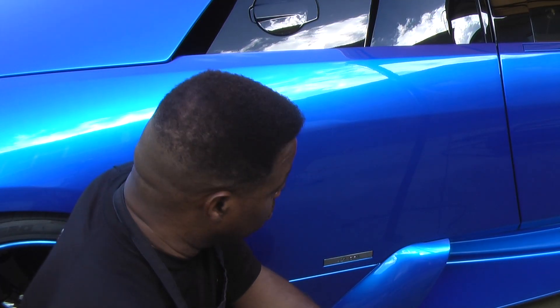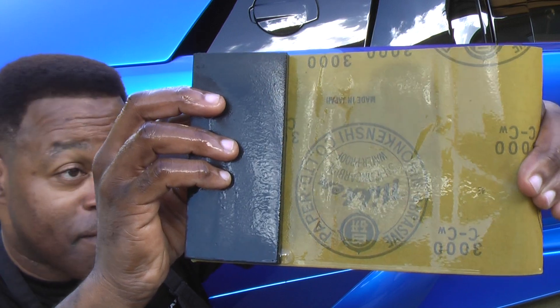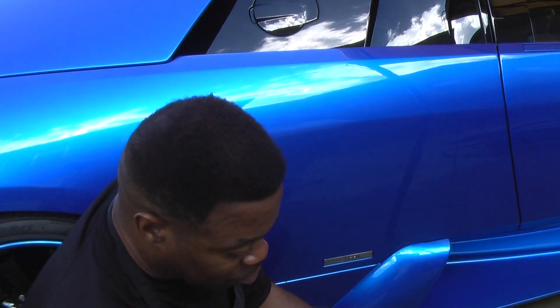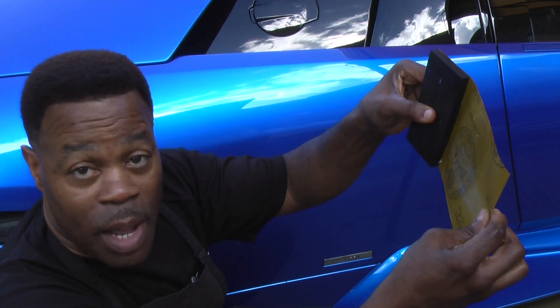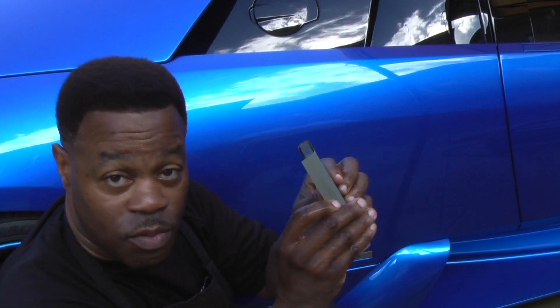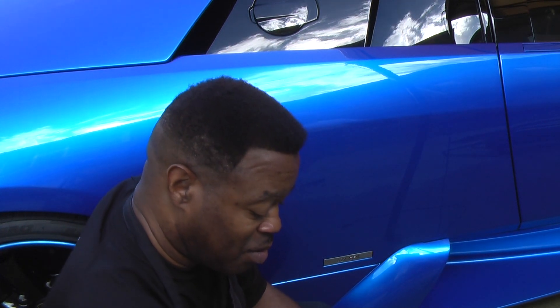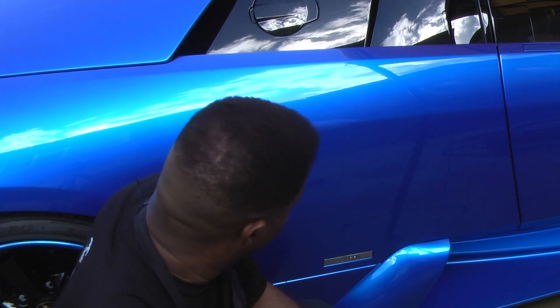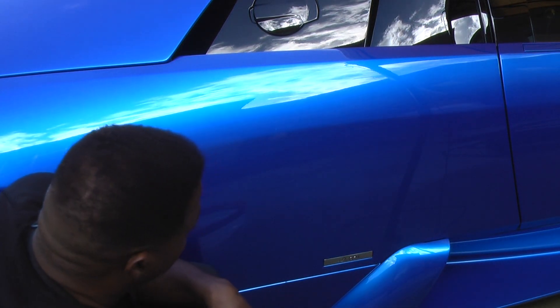They're not very deep. I can't catch them on my fingernails, so they're going to be relatively easy to remove. So here we go. What I'm going to use — those scratches are not too bad — is some 3000 grit sandpaper. That is probably all I'm going to need. I'm going to wrap my sandpaper up in a sanding block. That is a foam sanding block, and it's very important — you never use sandpaper by itself without the sanding block. Another thing: never try this at home. If you do, make sure it's something like a $2,000 hoopty. So here's my two areas that I'm going to be working: scratch one is here, scratch two is here. I'm going to give at it, so here we go.